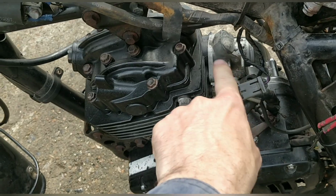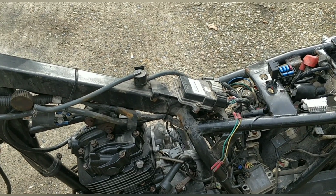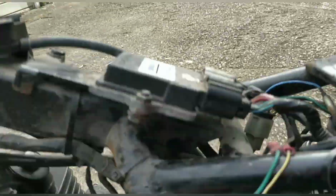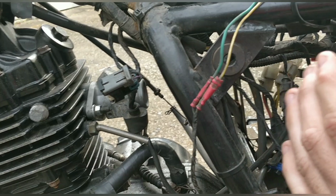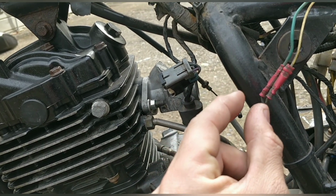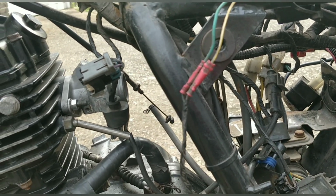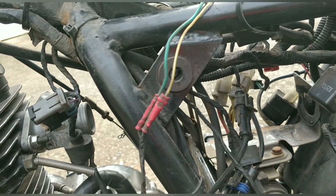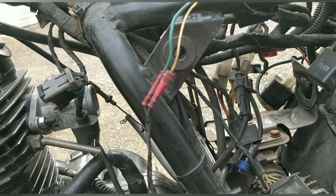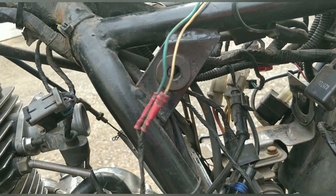We've got the new intake, the old intake actually, but it's got the holes blocked off here. The carb is about somewhere and ready and clean, and that's all good. One of the issues we had was the carb sticks out a little bit more this way. Now I've taken off a touch there by taking off a spacer, and I've taken off a touch on the carb by pushing it into its boot more. I do want the original airbox in here. I just prefer it. If it's a huge issue, I will get a cone, but it will be kind of protected under here anyway. But ideally, I want the airbox on. Apart from that, there's nothing much to worry about, really.